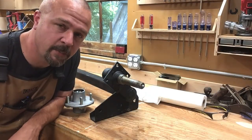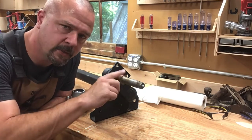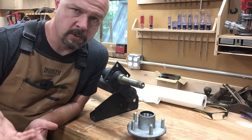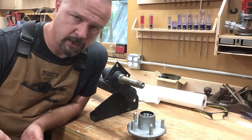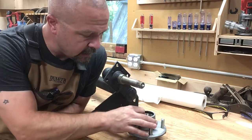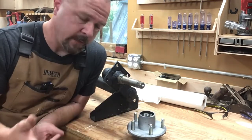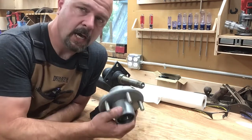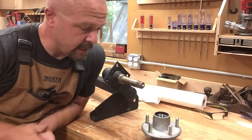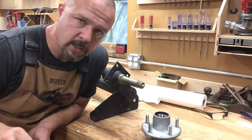Hi folks, welcome to Greg's Workshop. I'm Greg and today we're going to do trailer bearings. Probably one of the most important maintenance items on any small trailer — boat trailer, utility trailer — whatever, is the bearings. These things can get dry, they can get worn out, they get overheated, and when that happens they often break and this goes flying along with the tire. So I'll show you how to put them together properly from the start.